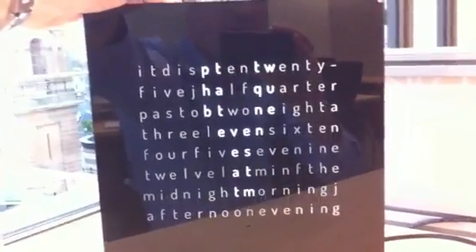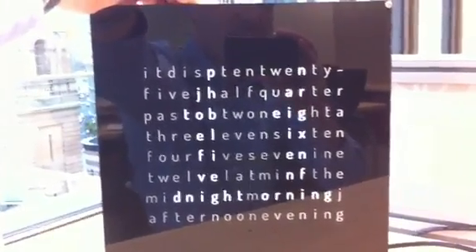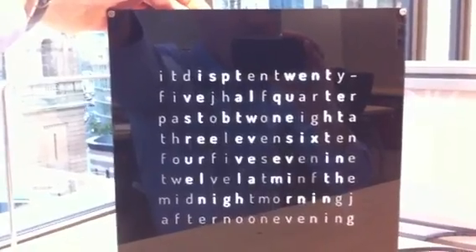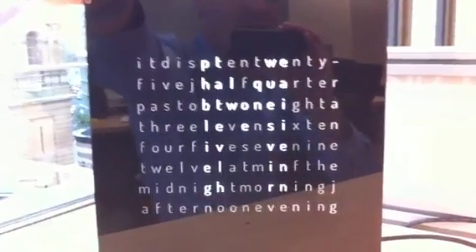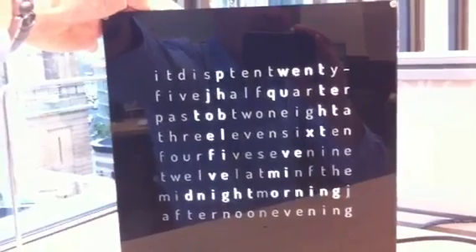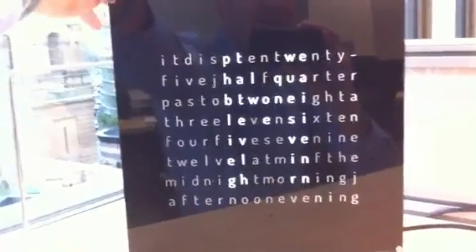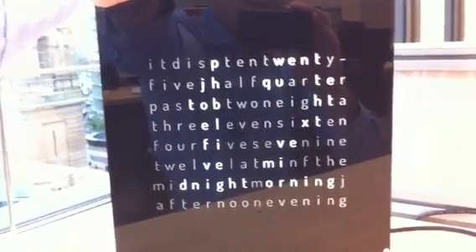It's alternating between the letter Y and the year. Press up or down to adjust the year — here you can see 2011, 2012. Press the mode button to advance. Now it takes me to M for month — showing month 8 for August. You can press plus or minus to adjust. Then set day — 21st. H for hour — 17 hours. And M for minute — 12 minutes. To make any change, press plus or minus. When you're done and want to synchronize seconds, simply exit the mode by pressing enter, and that will reset the clock to the current time.